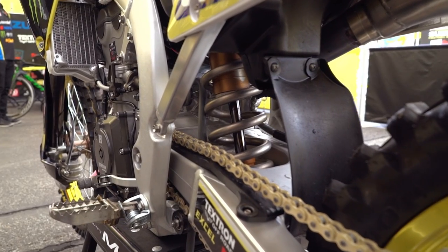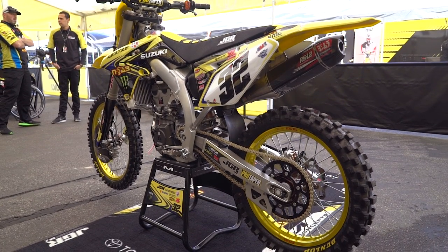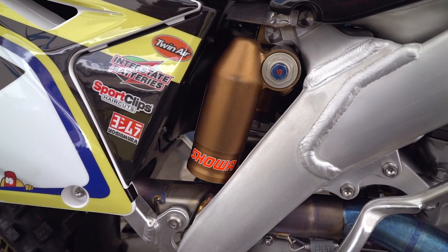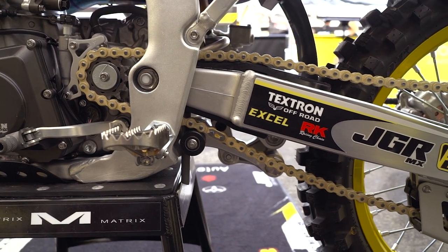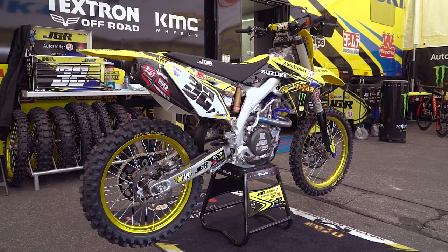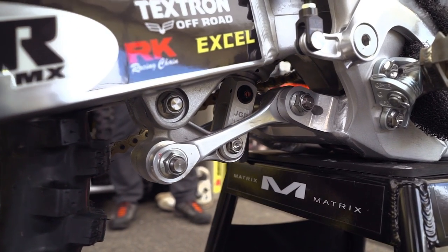On the rear of the bike, the shock is Factory Showa suspension with a titanium spring. Supercross is typically — I don't want to say stiffer is better, but unfortunately that's kind of the name of the game — stiff is where it has to be, and as long as it's stiff enough to forgive all of his errors on the track and allows him to bank off berms and riders, he's pretty happy. The stock linkage was really fine for everything we needed, but we did want some adjustability so we developed a custom pull rod that uses interchangeable pills to determine pull rod length and therefore adjusting the progressive feel of the shock.